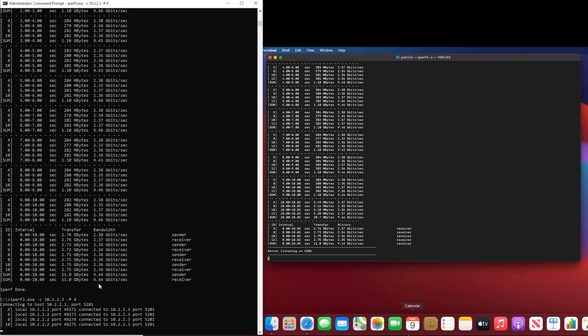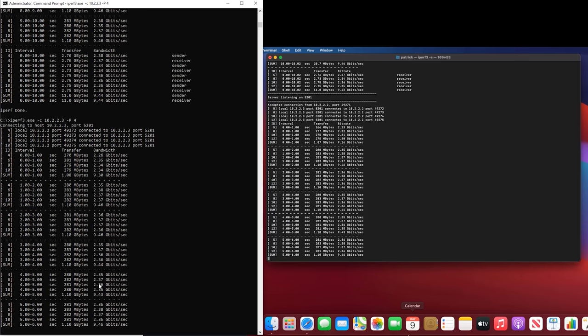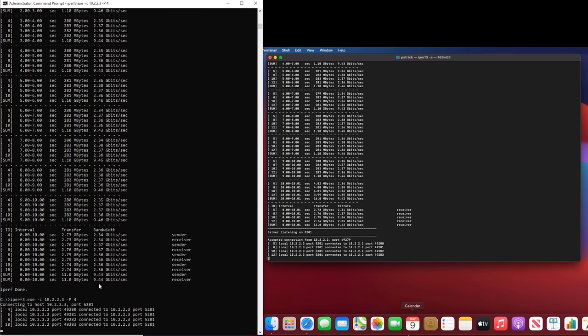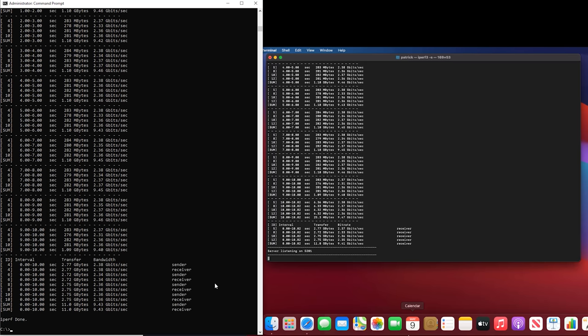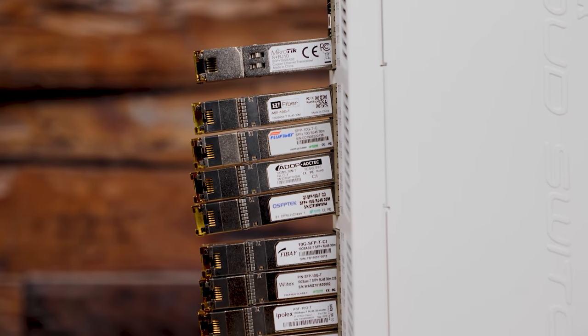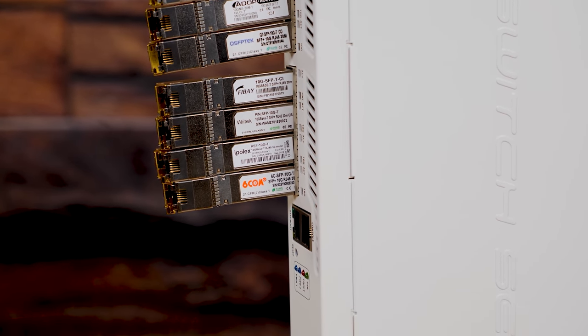We had to test it out to see if that was actually a bottleneck, and as you'd expect, that was not what we saw at all. The iPerf3 test shows nine-point-something gigabits per second — it's pretty normal to get a little below 10 gigabit speeds on a 10 gigabit NIC. So this is effectively a 10 gig ethernet connection. We're also doing a simple test just to confirm we're above 8 gigabits per second, proving we're not on a PCIe Gen 3 link. If you want to use an SFP+ switch with a system like this, we also did a piece on a 10G Base-T to SFP+ converter.